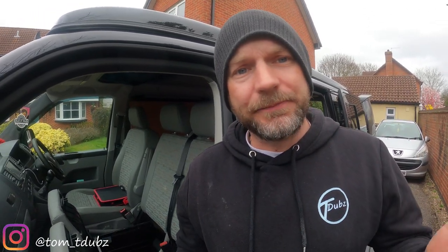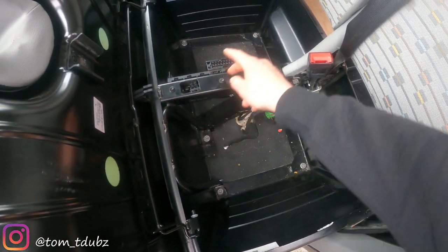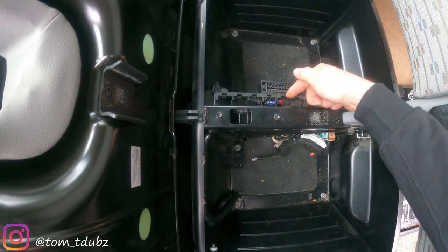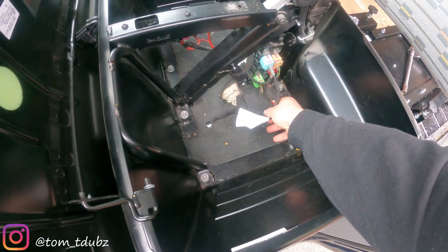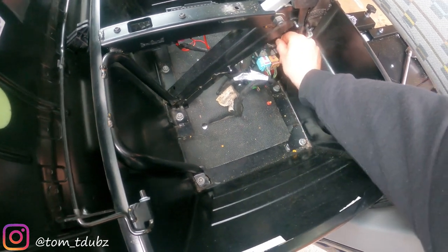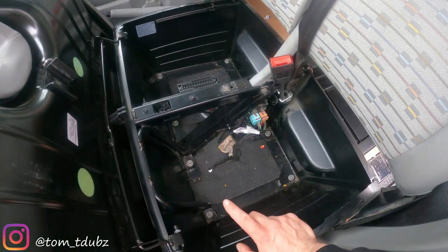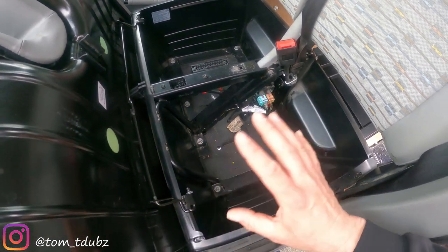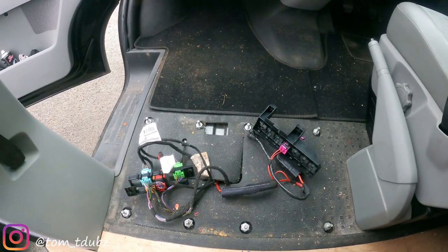To start with, we need to remove the double seat. To do that you're going to want to take out the eight bolts holding it in place, the two screws here holding all of this wiring loom — just for the cigarette lighter fuse — and this set of cables down the bottom. I think it's Torx 30 bits and 16mm bolt heads. I'm just going to get all that undone and then drop the seat out. Once the seat's out, we've got to deal with the wiring underneath.